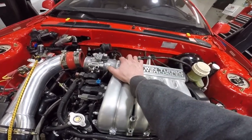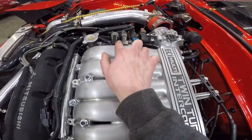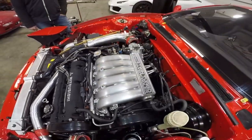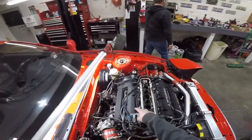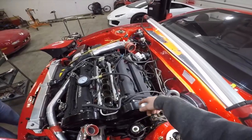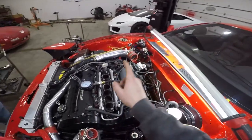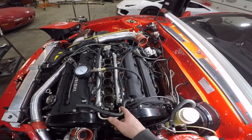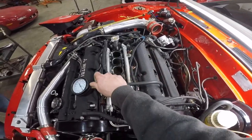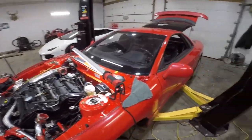Disconnect your throttle cable, vacuum lines — there's a ground back there, a vacuum line over here — disconnect all these plugs and then the manifold comes straight up. I'm also going to do a compression test on the back while we've got it all apart. Got all the plugs out, spark disconnected, fuel pump disconnected. Checking pressure now will clear out all the fuel so I don't make a big fuel mess when I pull the injectors. Front three all hit 150 — let's check the rears.